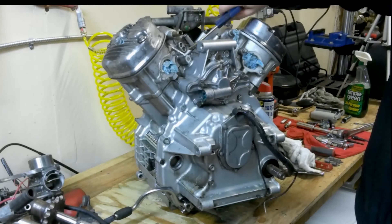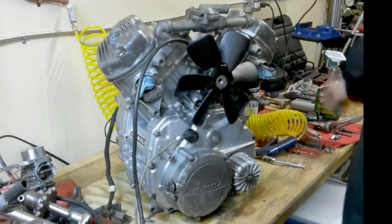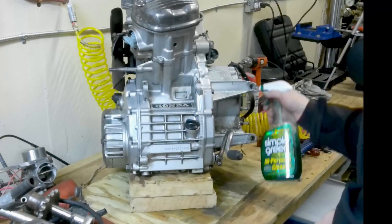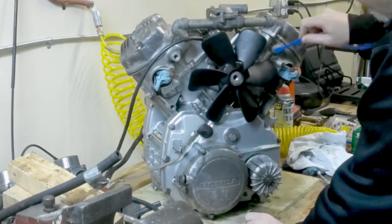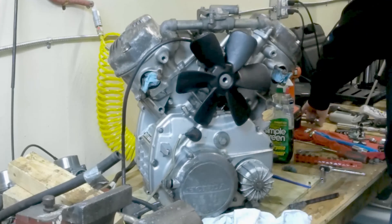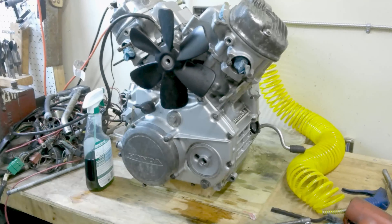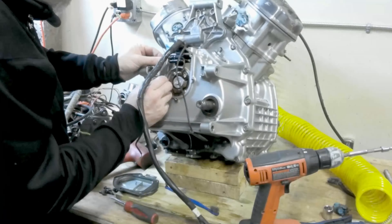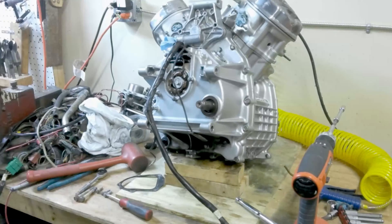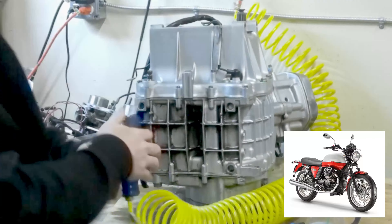This is a 40-year-old engine now, so I'm often asked why I chose the CX500. The transverse v-twin layout, which is rather uncommon in the motorcycling world, makes for a longitudinally compact design. Since the engine is sitting behind me, the shorter it is, the shorter the already long wheelbase is. I also love the look of the transverse v-twin with the engine heads popping out of the side right behind the rider's back, and imagining the exhaust sweeping forward, down, and then back up is quite intriguing. I like the look of the platform and I really like the Moto Guzzi v-twins for the same reason.